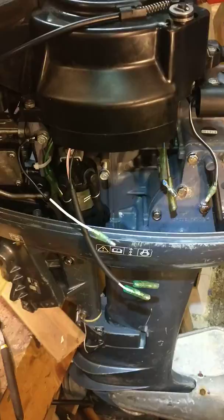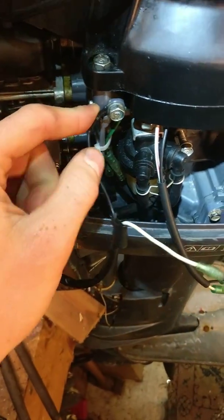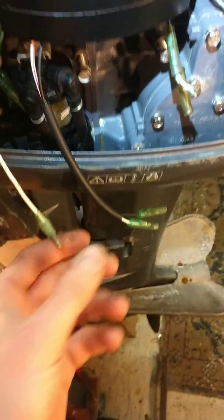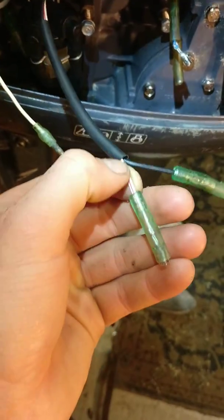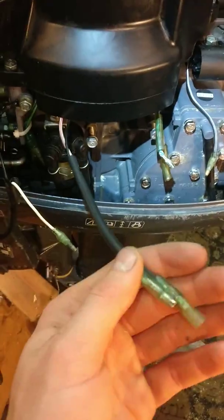On the outboard there are a few wires to note. On the left there are two green wires — ignore these, they are not to do with the spark at all. There is a wire coming from the kill cord: a white wire and a ground wire. Leave the ground wire in place and keep the white wire where it is — that will be plugged into the CDI unit. There is then a wire coming from underneath: this is the pulsar coil unit. There are two wires — a ground wire, a black wire (all ground wires are black), and a charge coil wire — red and white.